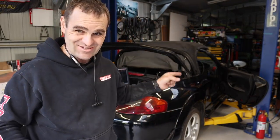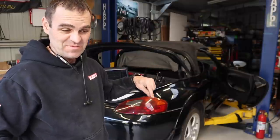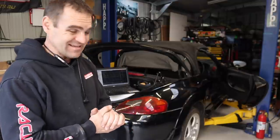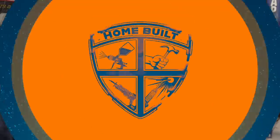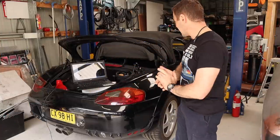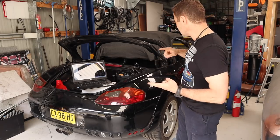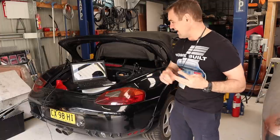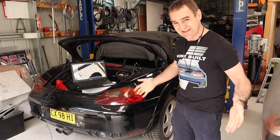I don't hear the pump, but it's got a hideous belt squeal. I think that may be because it's got fluids on it from what was leaking before — that's probably why the belt is squealing. So let's see if we can sort out the belt squeal and try again. I've done a couple of fixes now, another couple of tests. Let's try starting it again, see if the belt is still slipping, see if the power steering is still making horrible noises, and see how the lambda sensors are going. I've got a couple of fixes in for them, so let's take another log and see what happens.